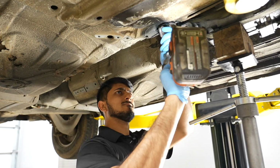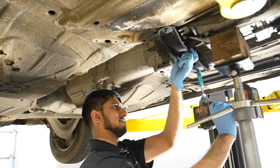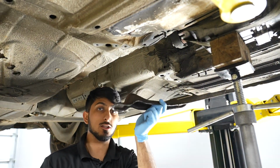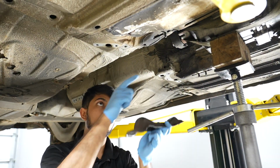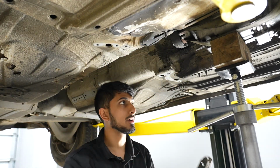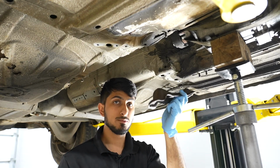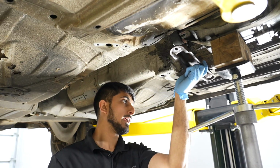So I just took off the automatic transmission crossmember that was factory on this car, since it's an automatic. I've got a manual one right here. It's a little bit different, but still has that same angle because these are both not exactly even. One side's higher than the other. So we're going to try to adapt this to accept the 6-speed manual out of the E46 M3.